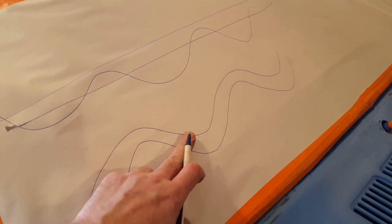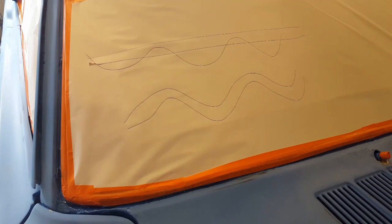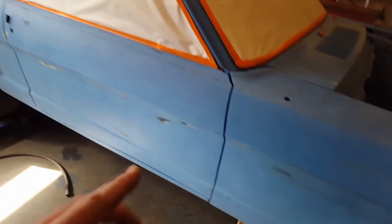I've run into problems over the years where you have a primer and you put it on a car and it bridges. So when it's all primed, it looks perfect. You'd almost be able to scuff it and go. You couldn't see none of the bodywork on it. When I applied this primer, every spot on this car where I had bodywork done, I could see all the rings and everything sunk in around it, because I knew that it wasn't bridging, so it was good quality that way.